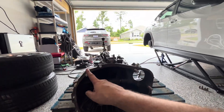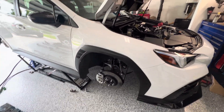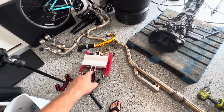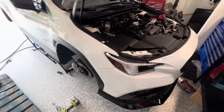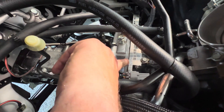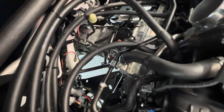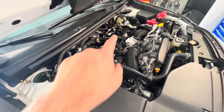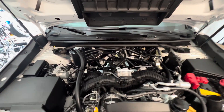All the bell housing bolts are out, kept in their locations from where they came out. Last thing is to take off the transmission cradle — I've got the trans jack ready, going to get it wheeled under and secured. Looking up, since this is a brand new car, you can already see it starting to split — I could fit my fingernail between them — so it's not going to give me much trouble disconnecting from the motor. Let's get the trans pulled out.